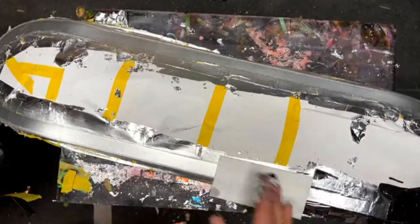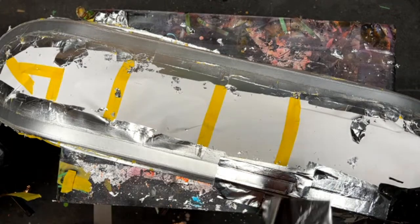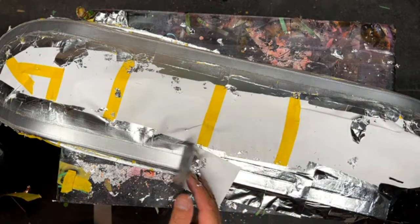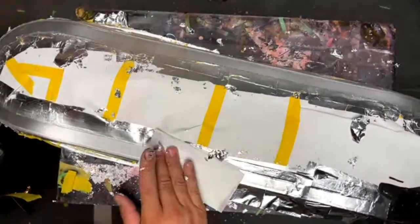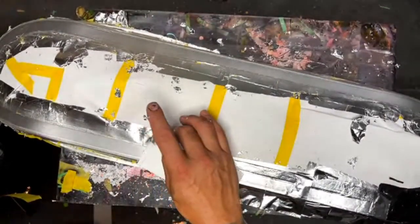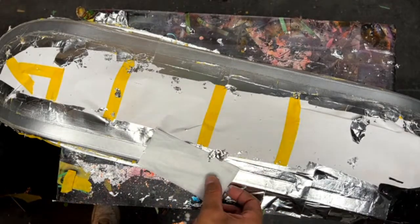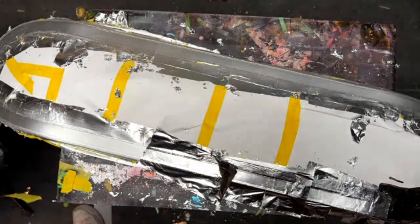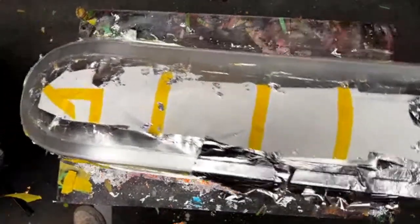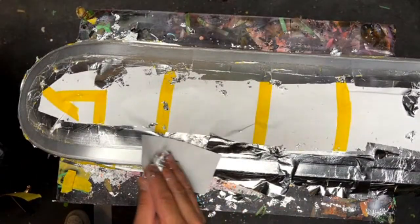What's the reason for doing the second layer? So we're going to spin this with a 5,000 grit pad on a spinner, and it's most likely going to prevent any kind of burn through if that happens when you go to spin it. If you have imperfections and contamination, obviously you could still have some problems with burn through. Also, if you're not pressing down your edges good enough.